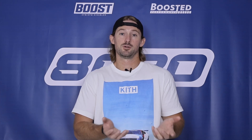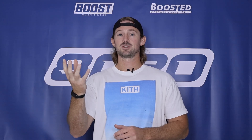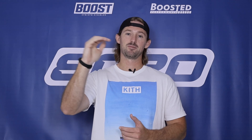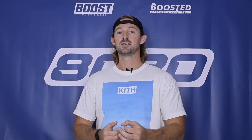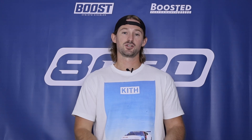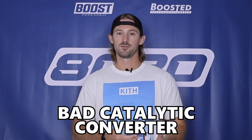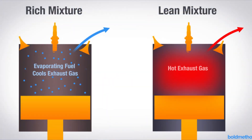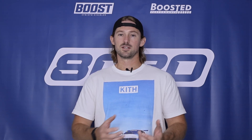The second cause is actually having way too much oxygen right around the sensor, which points to an exhaust leak. If an exhaust leak occurs before this oxygen sensor, outside clean oxygen gets pulled into the exhaust system and the sensor reads that. This is a very common code associated with exhaust leaks. The sensor isn't giving a bad reading — there's just so much clean oxygen entering the exhaust that the reading is extremely low. So it's either the sensor itself or an exhaust leak; in rare cases a bad catalytic converter or an engine running lean, but those come with symptoms.